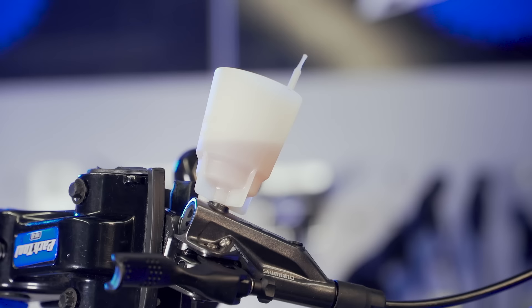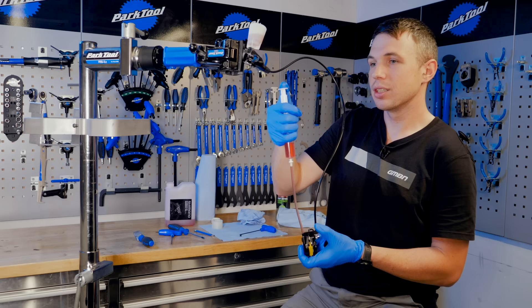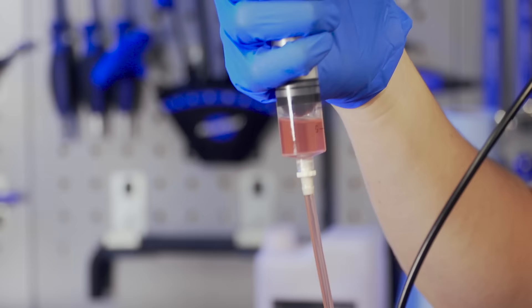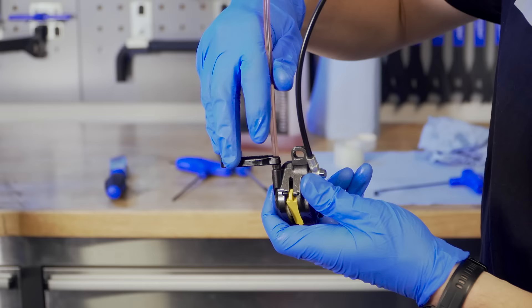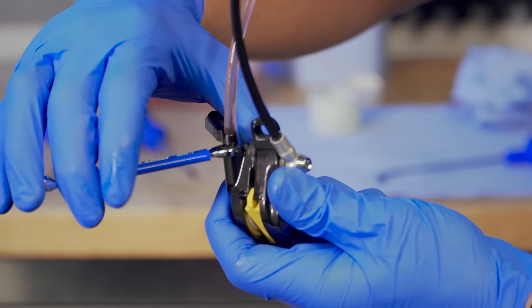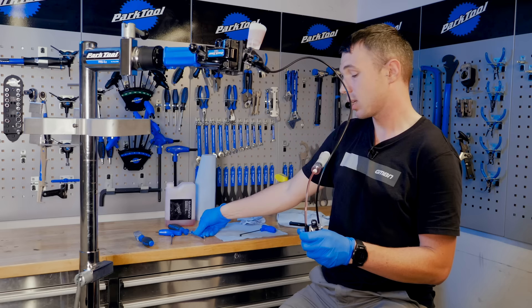What I've done in the past is alternate between Shimano fluid and some aftermarket fluid of a different color — it makes it really easy to see when you've bled the full system with clean fluid. Logic dictates there's only so much capacity and the amount we put in will have passed through. Then using the lever on the bucket, thread in the bleed nut a bit, and with the 7mm spanner using moderate torque, nip that up. You don't need to be swinging off it, just firm.